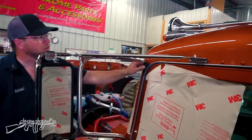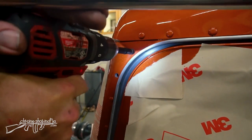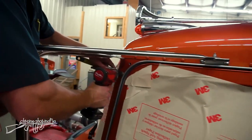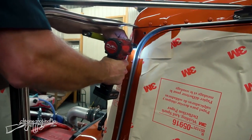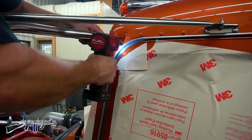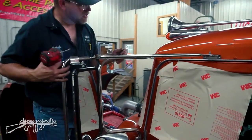The cab holes are oversized to 13/32 inches and a threaded insert is installed in each — a small steel insert with a quarter-inch thread. A cordless impact works great for this; the insert goes all the way in and is slowly tightened until it can no longer turn clockwise. The process is repeated on the other side.